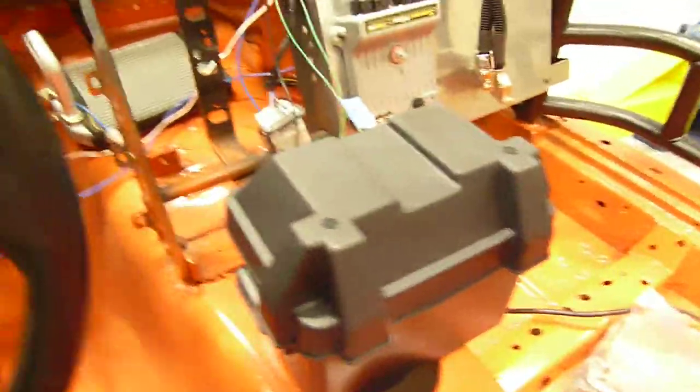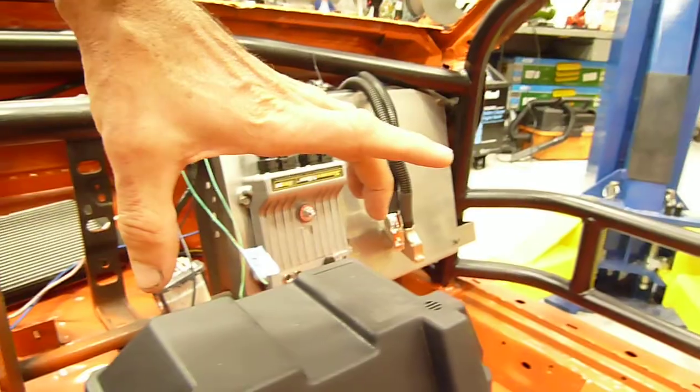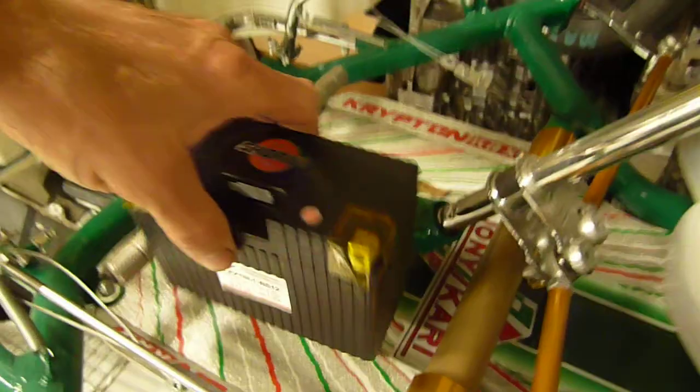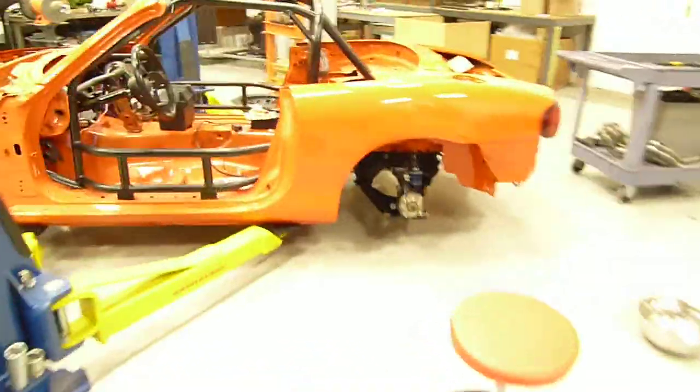It's our battery box — the smallest battery box I could find. The battery we're putting in is actually a little tiny lithium battery, about that big, weighing about two pounds. We found they're quite a bit more durable when the charge gets under or over its rated amount — the little AGM batteries aren't very durable. So we're using one of these little Shorai batteries. It weighs about two pounds, very light, but it tolerates a lot more abuse than an AGM battery.